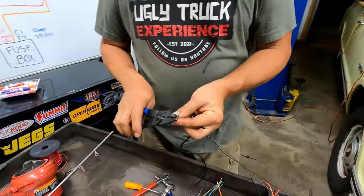Okay. The check engine light does not need, like if we didn't run this one, if I turn the key on right now, it'll come on for a couple seconds, because like I said, the PCM's its ground. So we'll do a bulb check when you turn the key. There you go. Watch that. I'm going to turn the key on for a second, and if we've done a good job, that'll light up for a couple seconds. Cool.